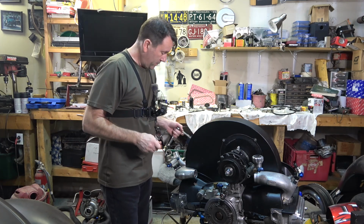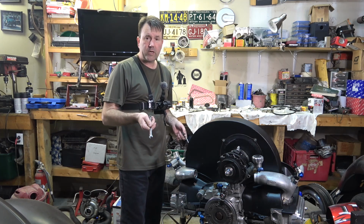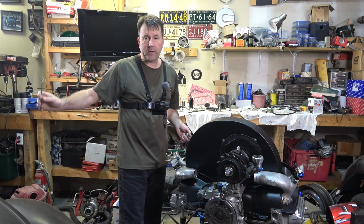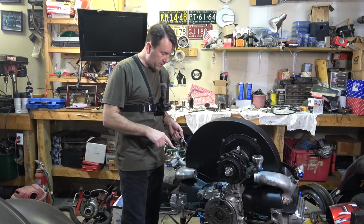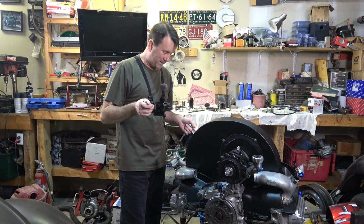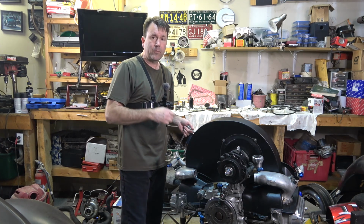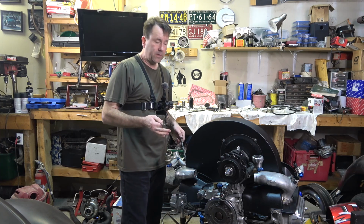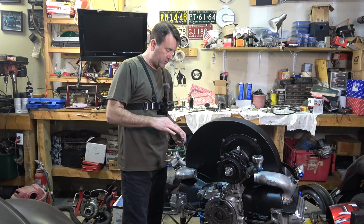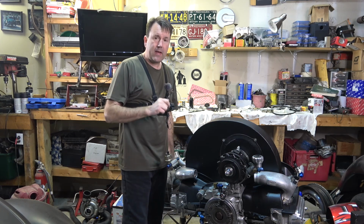But what I've got is ground straps, since I'm running fuel injection. The ground straps hook to my coils, and also run over here. Let me try to explain this properly. You want your heads grounded with a good ground from the coils. Otherwise, the electronic fuel injection just doesn't work. You don't get that good spark. Actually, you want a good ground pretty much all over the car.